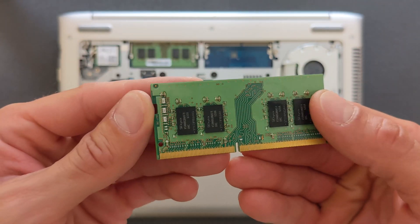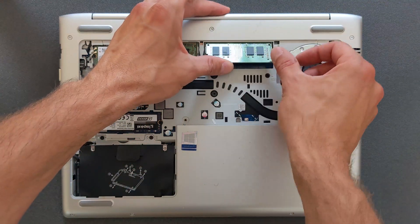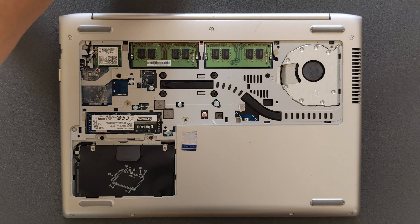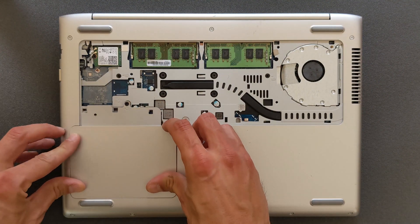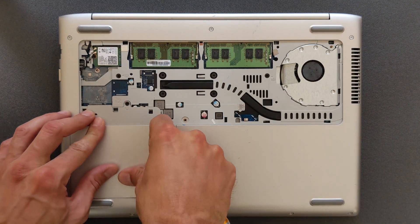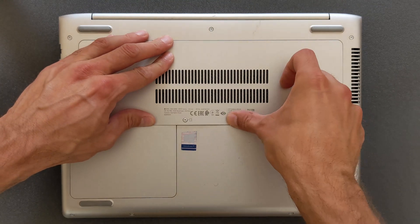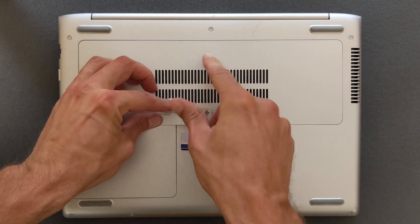You can actually get the serial number from the sticker on the RAM stick, but I'll leave it in the description anyway. One thing I recommend before closing the back panel: turn the laptop around and turn it on to see if everything is functioning — it saves you the hassle of opening it up again. Then put things back the same way you took it apart. Push the panels in because they don't sit in freely — there are little clips. Close the screw and push it in, and that's pretty much it.